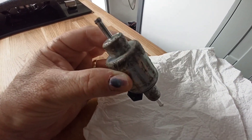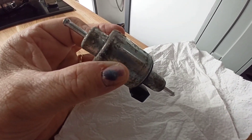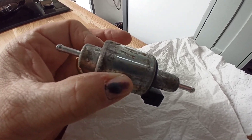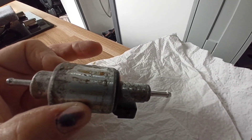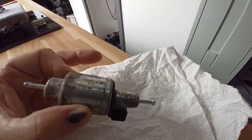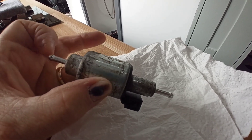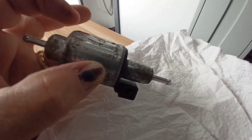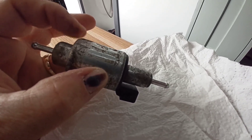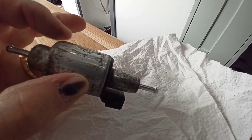Now as you can see, this is a clean tissue. This pump is designed to form a seal between the inlet and the outlet, and it works by a little piston inside operated by a magnet — when it passes an electric current, it goes in and out, causing it to suck fuel out one side and blow it out the other. Now when it's switched off, it should stop the fuel, so regardless of where the tank is, you won't get any siphon effect of fuel passing through the pump.